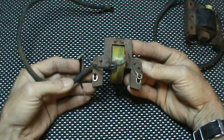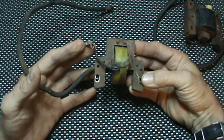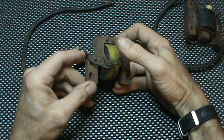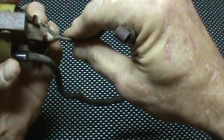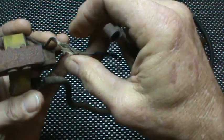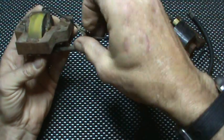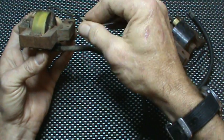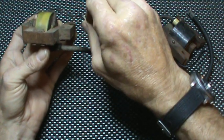Here's number two. This is what most everybody sees who has a coil with points attached to the side cover or to the side of their engine underneath the carburetor — just to the left. Standard coil. What happens with these most times is your epoxy may go bad, or mice. Mice will chew through your insulation and this will cause a breach in the circuit. This is your output; this is what goes to the points. This can be repaired rather effectively using shrink tube — put the first piece on, heat it up, shrink it down, put a second piece on over top, heat it up, and shrink it down. It gives you really good insulation, so you can reuse that coil.